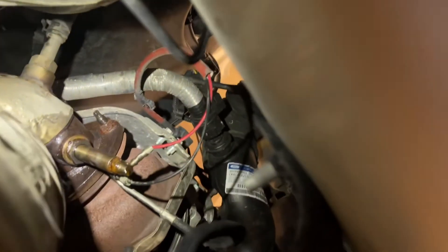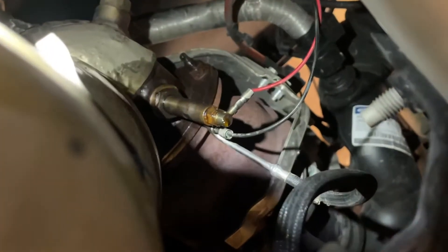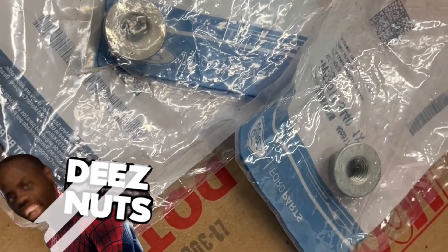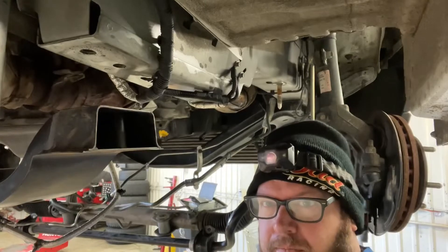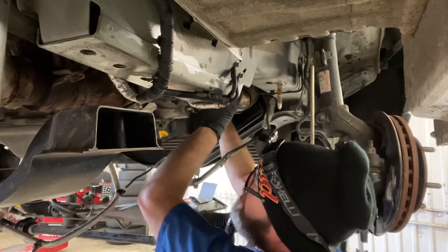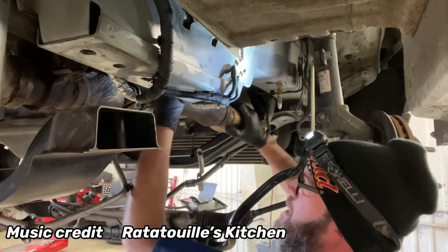This thing is attached on top, right on the turbocharger. The turbocharger is right there, and there's another sensor there that's kind of in the way, but I brought it down with that one still attached. Those bolts were quite a challenge to reach and unbolt, but after a lot of finagling, body twisting, and swear words, I did finally get those nuts off. They had to be replaced with new ones out of the bag. Finagling that catalytic — whatever it's called — out of this Transit van after it's been unbolted was a challenge as well.